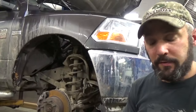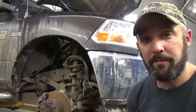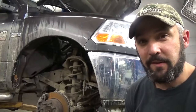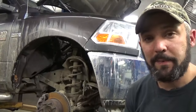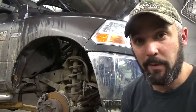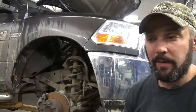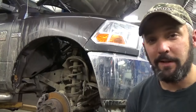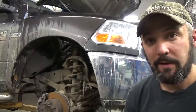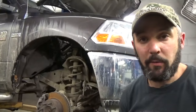Well, there you go, viewers. A big welder, a couple of nuts, a little bit of patience, and it can save you a whole lot of time drilling or having the potential to drill through a water jacket or drill the bolt hole crooked or, you know, any of those scenarios, breaking off a drill bit, breaking off an easy out, any of those things are gonna completely ruin your day. This is a really great method to start with. As you can see, it works pretty well.